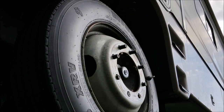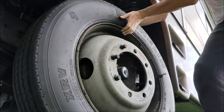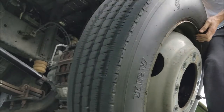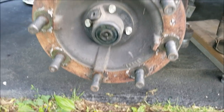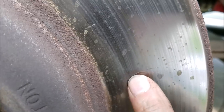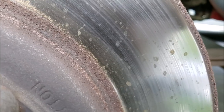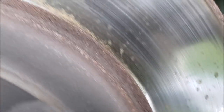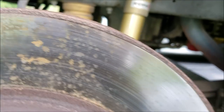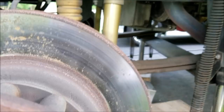The wheel is off. I'm just starting to get some cracks — little micro cracks. The other side is even worse. I even checked the rear discs; they're starting to crack also. Luckily I found this early so I can do it at my leisure. I'm not going anywhere for the next two or three weeks, so I've got time to take care of it.